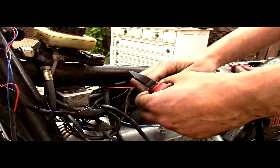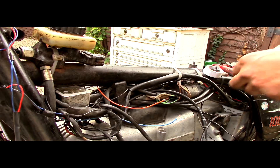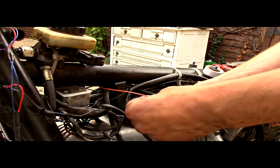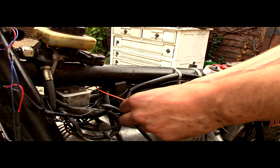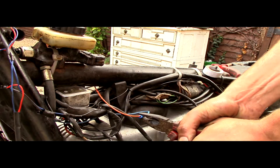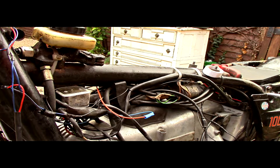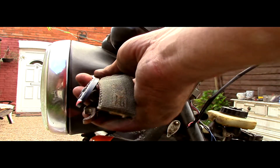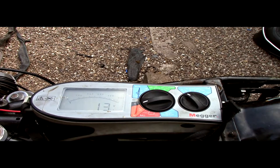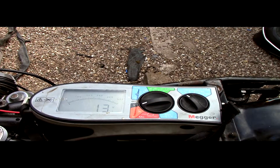So just chop it, skin it — both sides. We've got an inline connector block here — squash them all together like that. Check to make sure they won't come apart. Put it all back together: the headlamp, the tank on. And we'll start it up and make sure we're getting 14 plus volts through the battery. And there we go — it works! A brand new integrated diode and regulator. Thank you for your time. Bye bye.